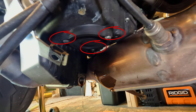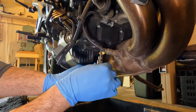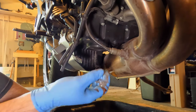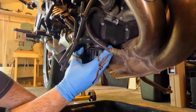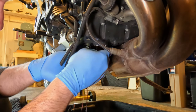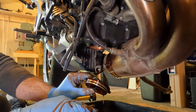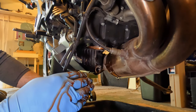These are the three screws that need to be removed to take out the oil filter and they use the T27 Torx bit. Once I get them loosened, I like to just use the extension and the bit to remove them by hand. They're small screws so you don't want to overstress anything. Be careful because those tools are slippery when they're covered in oil. Once the three screws are removed, there is an O-ring around the bottom part that is going to keep it snug in there — just work it back and forth and wiggle it until it comes out, and you're going to get a bunch of oil that pours out. The oil can burn you if it's very hot, so make sure you let the bike cool down. In between the oil filter and the bottom piece there is a spring which can pop out into the oil, so be careful not to lose that — the first time I did an oil change, I let that fall into the oil and had to dig through it.